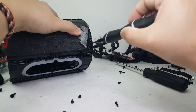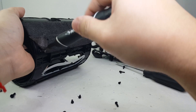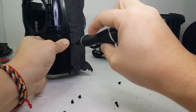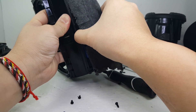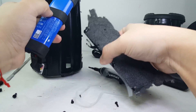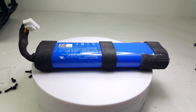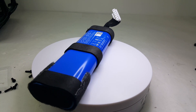Now we will take out the battery. To do so, we will remove six screws that are holding down the cover to the battery compartment. Once the cover is removed, the battery just pops right out. This is a 5000mAh battery pack that takes around 2.5 hours to fully charge and provides the speaker with a play time of up to 15 hours on a single charge.